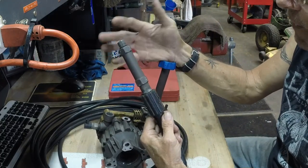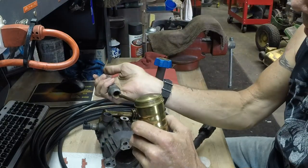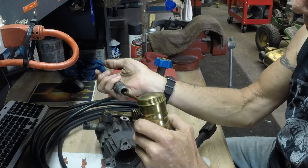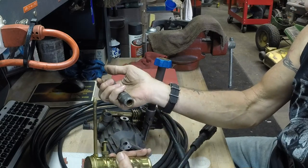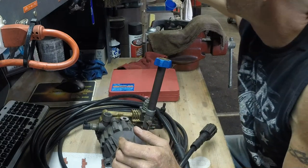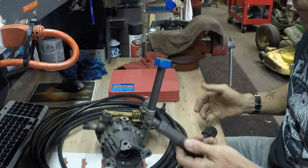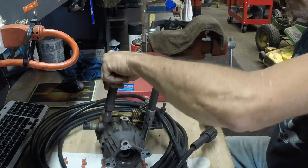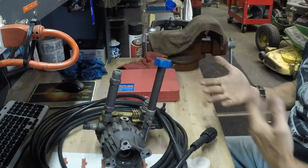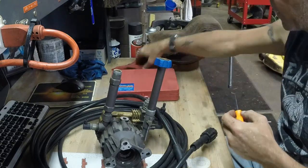You can't do that. You've got to take this stuff apart. Take a little bit of oil, put it in there so you're keeping the surfaces — I wouldn't use anti-seize, just a little bit of oil. A little bit of preventative maintenance goes a long way. It also helps prolong the life of your O-rings, provided that your O-rings are petroleum product safe.